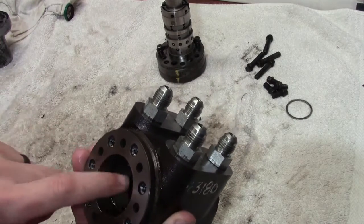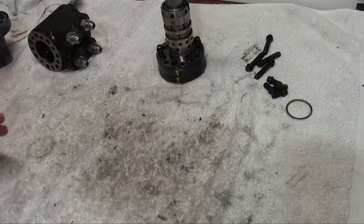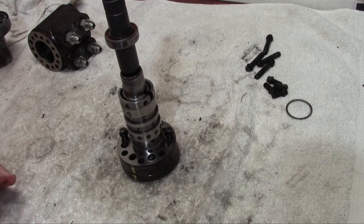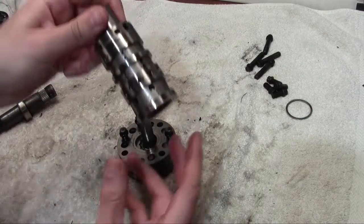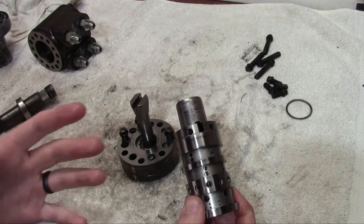The flow actually flows into here, through here, and then gets routed back to wherever it needs to go. The part that actually does the routing is all here — this is really the brains of the whole thing. We've got our steering shaft there, and then this section here, which is your valve section. This is going to be what controls where the flow is going.